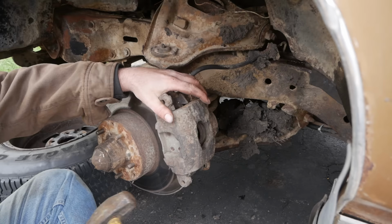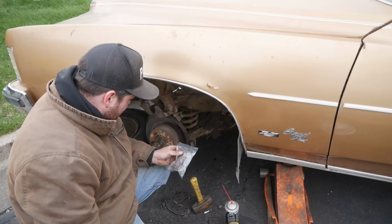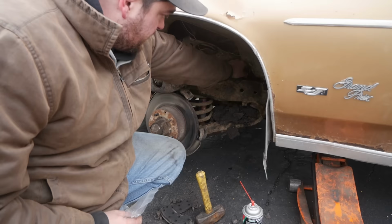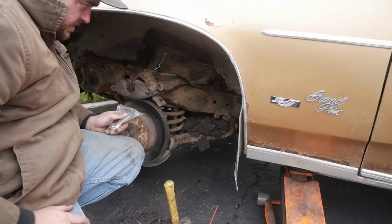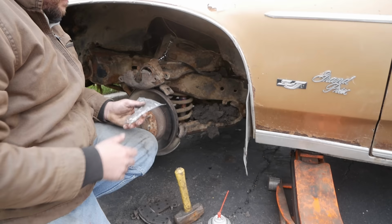The rotor doesn't look that bad. No, it's nice and turned. It's definitely wearing the pad. Yeah, it is. And it's crumbling. Ooh, shiny. That brake line looks pretty good. Yeah. No, I mean, really, the metal line back here, it's hidden. They put it behind the frame. It might break free. Then we gotta bleed it, but technically we should bleed it now anyway, but it being spongy and not working that great might actually be to our benefit.